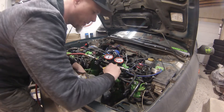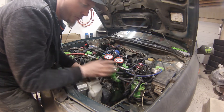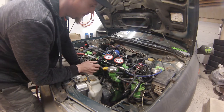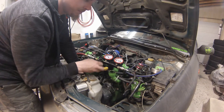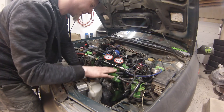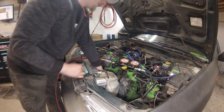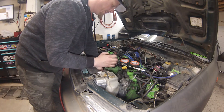I think we're getting close to top dead center on number four. You can actually hear pressure coming out of here - the mic can pick that up because it's just huffing out of there. If I put my hand over the oil filler, you can see the bubbling and gurgling coming out of that valve cover vent over there. So yeah, number four is definitely damaged.